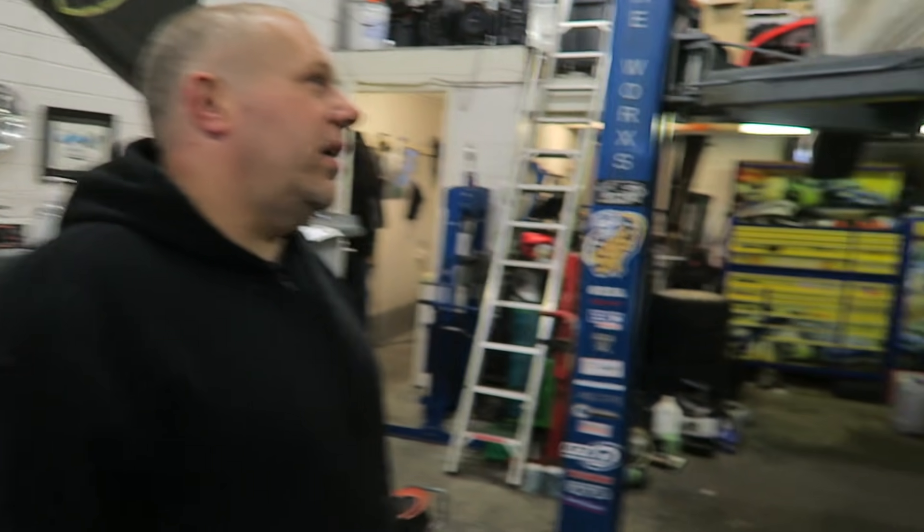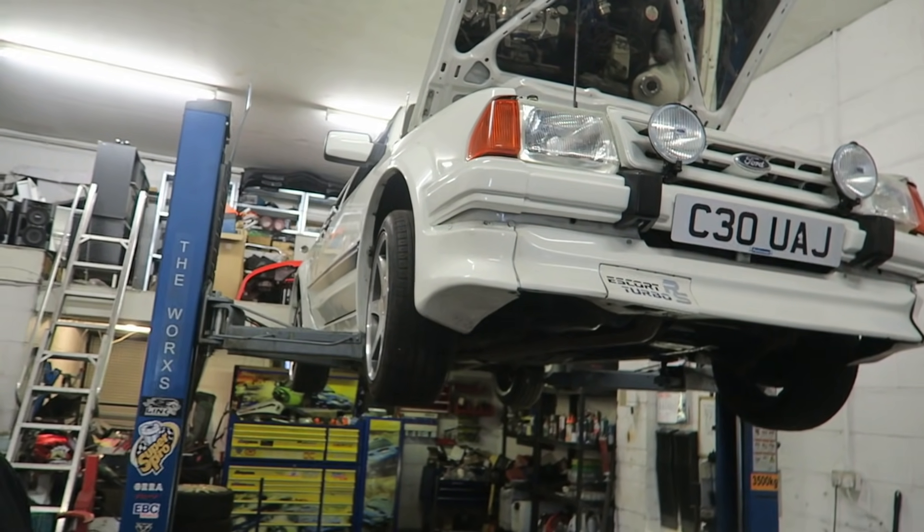The first thing I got a call about yesterday — the actuator was wound out to a point where the boost comes on quite hard. We haven't put a gauge on it yet because we wanted to go through the car first. We're nearly at a point now with the alternator sorted, so later this afternoon I'll put a boost gauge on it and an AFR gauge, and go and see what it's actually doing under load, because it might be quite a lot.